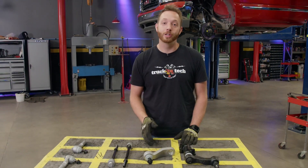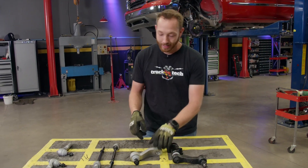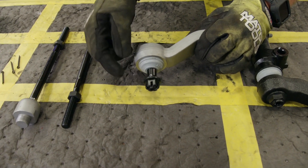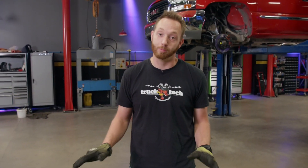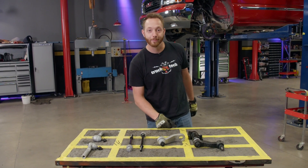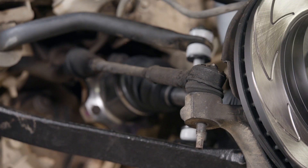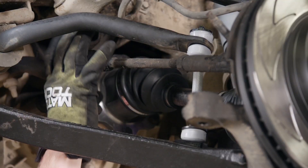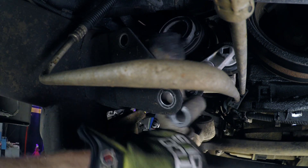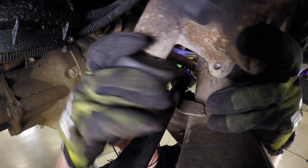These Duralast Gold chassis parts are engineered and designed with quality in mind, and they're going to last long even in a heavy-duty application. The balls in the joints have a larger surface area than stock for improved load distribution, and the studs are made from hardened steel, so needless to say, these are some durable parts. I know that front end work isn't the most fun thing to do, but as I'm about to show you, it's really not all that bad. In order to remove the tapered seats which hold most of these parts together, there are a few specific tools you'll need — basics like sockets and wrenches, but also a pickle fork to remove the pitman arm from the center link, and a specialized puller to get the pitman arm off the steering gear.